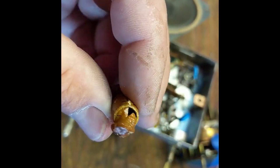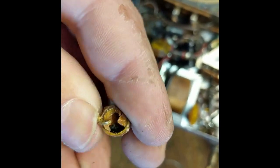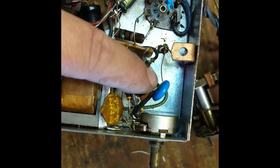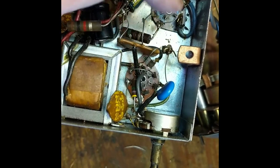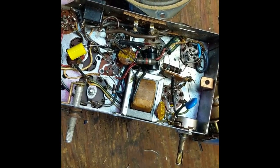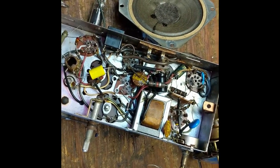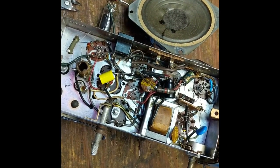Indeed, I think this is the culprit — that is a fused-together capacitor that was going across the output tube. I've replaced the rest of the caps — there weren't many. This is the most important one in here: it's a safety cap rated at 0.01 microfarads. It goes basically to the chassis — it's the other end of the AC incoming power. This is a floating hot chassis set. Back then they didn't quite understand how little it takes for a heart to start fibrillating. This is a lower value cap and it's a kind of capacitor that will split open if it gets hit with a wallop of power, versus fusing together.